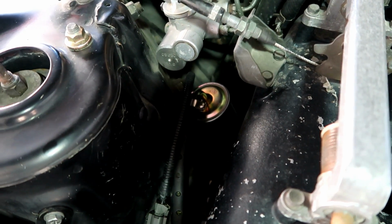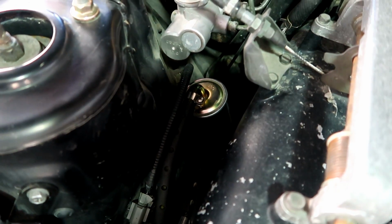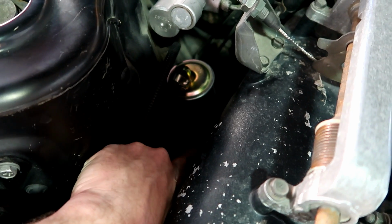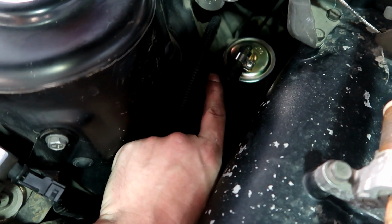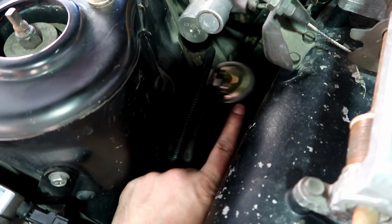These ones are pretty tough to get off. Hose wise, they're firm on there. There's no way those are coming off. Even without those hose clamps, I had a tough time pulling that hose off. Pro tip, do that bottom hose up and put the hose clamp on there before you put the top one on. I made that mistake, and it was kind of a pain to get that bottom one back on there, but once we did, we got it on nice and tight.